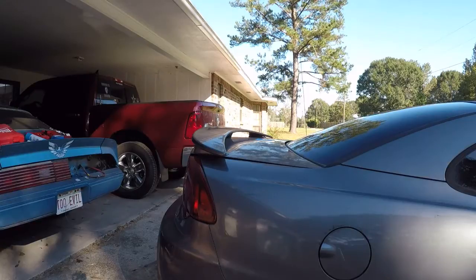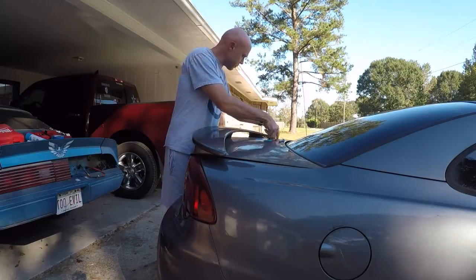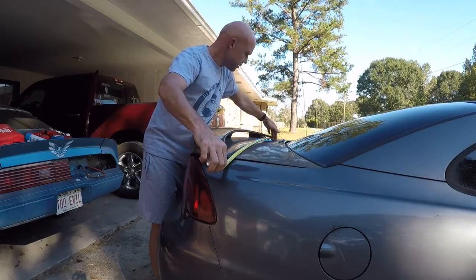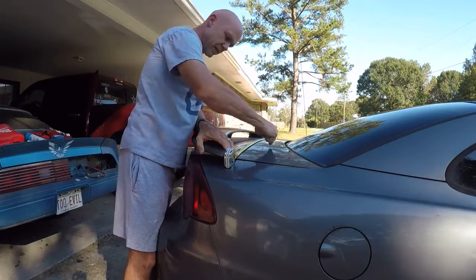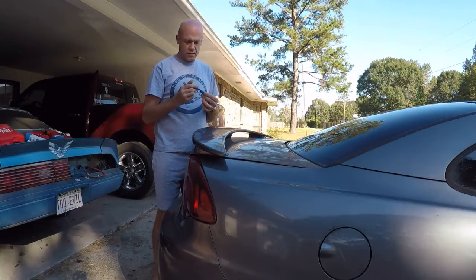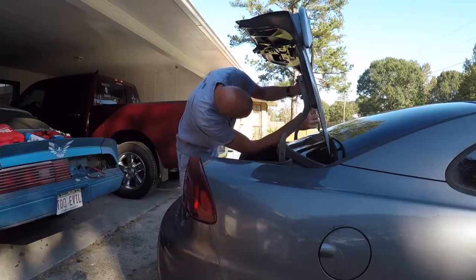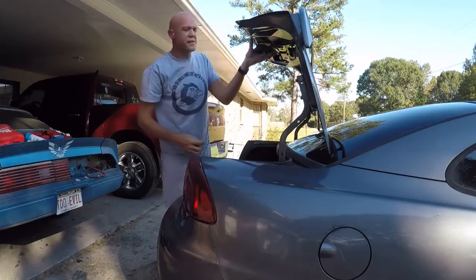That'll work. Blue Sharpie on blue tape, always planning ahead. I'm going to take a quick dimension across this thing, about like that, and that is right at about 46 inches. So we go just shy of 23. That should give me the center. And it looks about the center. We will double check this measurement at, let's say, 5 3/4.